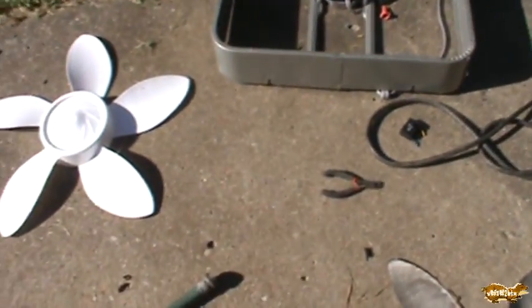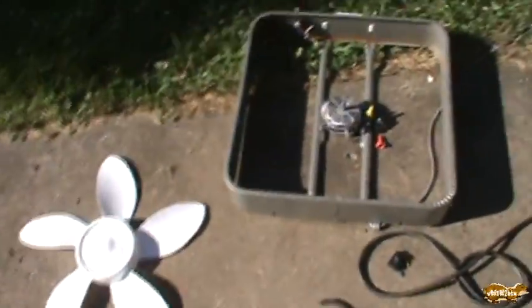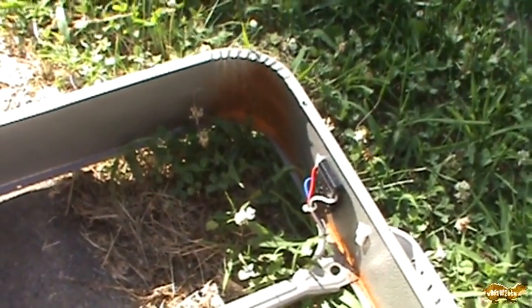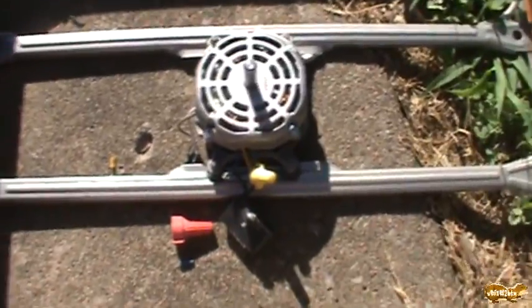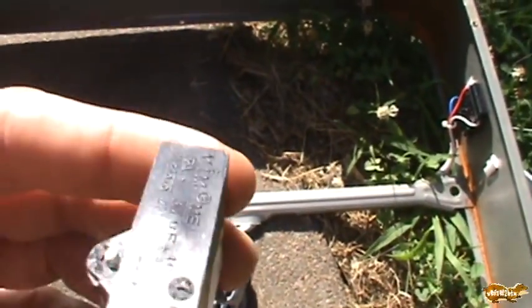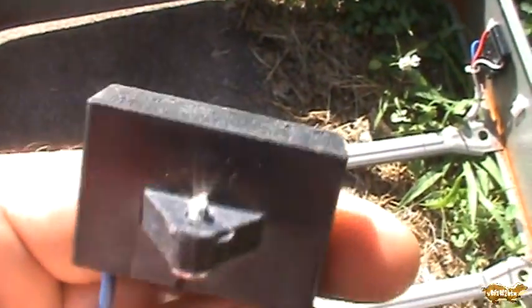Intertech, whatever that is. Anyway, I'm rambling now, but it looked to be in perfect condition but it didn't run. The blades would just kind of stall, but if you spun them they'd spin freely. And you can see there's already a little bit of rust there — I'm sure it's been rained on already. You can probably already see from this dodgy-looking wiring that I already had a hunch: the capacitor had gone bad. And you can see it's bulged right there. So I thought, I bet it's just a capacitor.